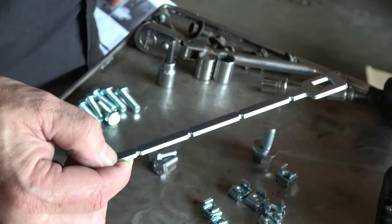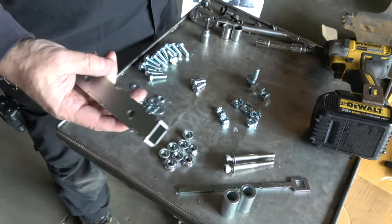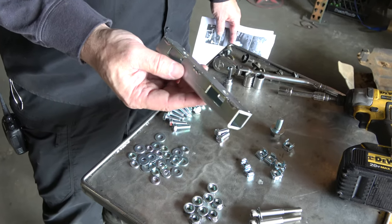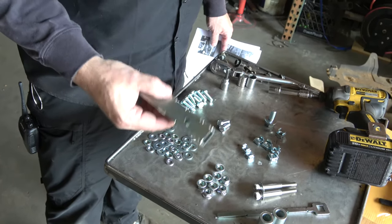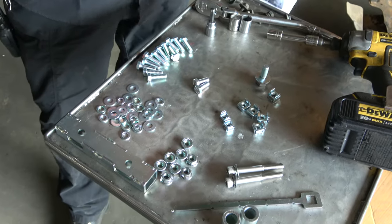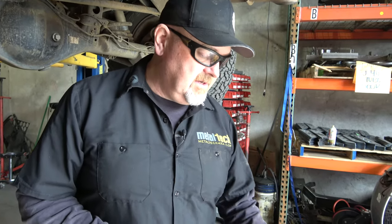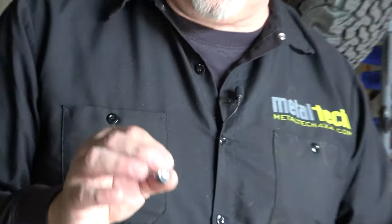There's a single 10mm bolt with a captured lock washer and washer that don't come off. They also gave us a cage nut tool — typically used to reach back into a frame or tight space. There's a drop-down for the mid plate if you need to lower it to help clear your exhaust in case it's rattling or touching. That's helpful if you've got an aftermarket big exhaust, but in theory this should go on without needing it since this is a stock exhaust on a petrol Prado 120 GX 470. The instructions have you going back mid-install to add cage nuts to already-installed panels, but it's way easier to install those right now before we put the panels up.